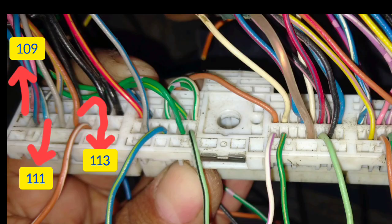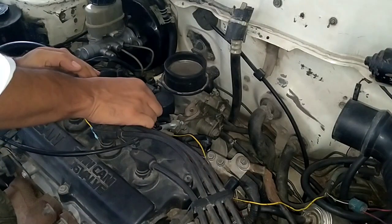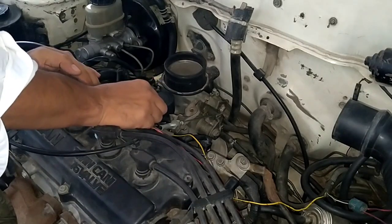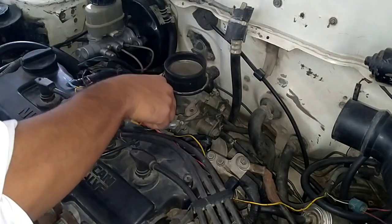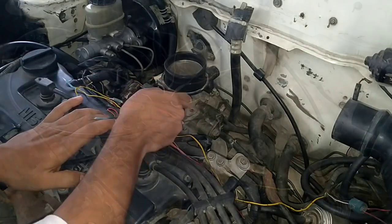Here are the 111 and 113 wires especially. Use patch cables for this purpose and cover the heads of the wires, because you must not short any of the wires — especially wires 2 and 3, and 3 and 4 — otherwise you will burn out your ECU IC of the idle control valve.